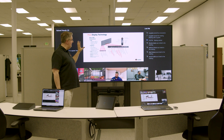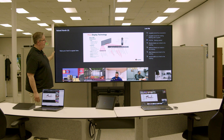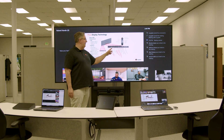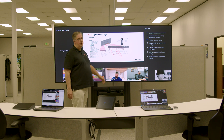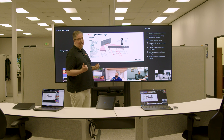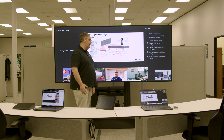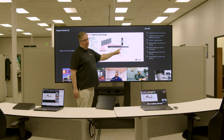There was a reason why I selected this slide in 21:9 format — you also have all the ports available. Right now we're using a 105D display-only model that doesn't have touch interactivity. If you were to add touch interactivity, you gain an extra HDMI port and three public USB ports. Public USB ports means you basically add a USB hub, and anything you plug into these three USB ports is available to all the inputs — whether USB-C, DisplayPort, or HDMI. The display-only model does not have this; it only has four USB ports available exclusively to the USB-C input. Also note that every port has its own reverse touch USB Type-B port that needs to be connected. So if you use DisplayPort or HDMI, you need to connect an additional cable to support the reverse touch function.